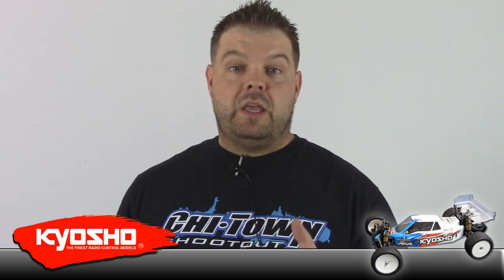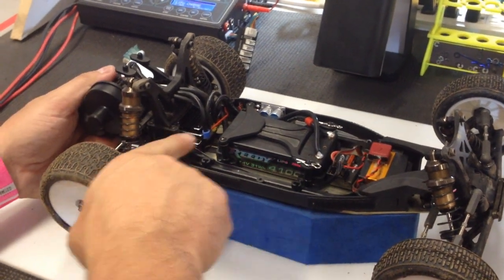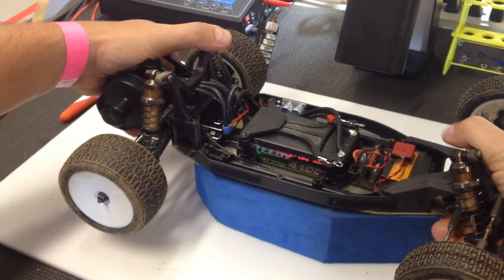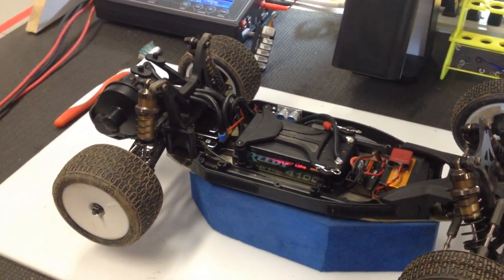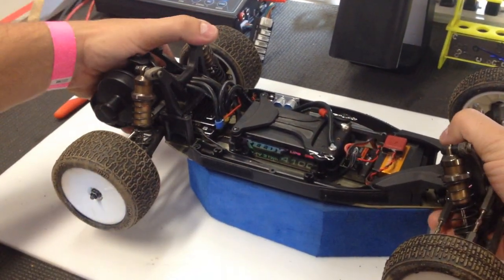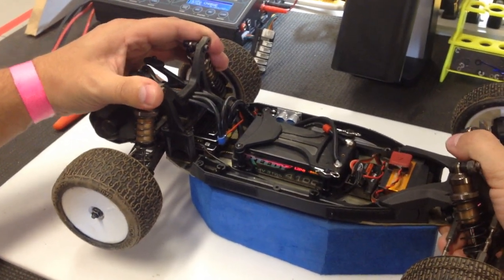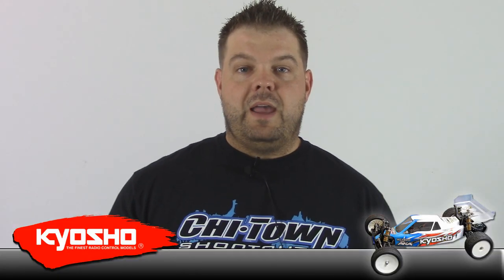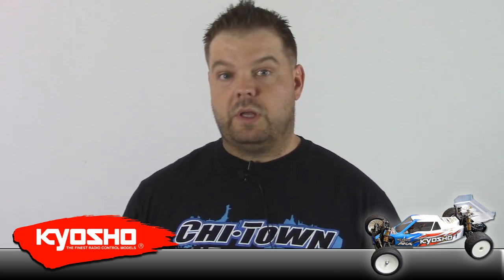So let me show you what I did. I went ahead and chopped off the front posts on the bulkhead brace right here. The same thing can be accomplished by just unscrewing them, but I wanted a little bit more room for the speedo. You can see that the chassis actually flexes quite a bit more — it's not dangerous, but it just gives the car so much more forward bite. So if you are struggling with forward bite, try taking those two front screws out of the bulkhead underneath the shock tower and see what happens. I think you'll be surprised at how much more forward bite the car develops.